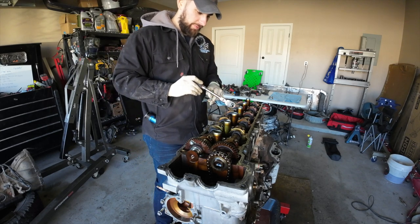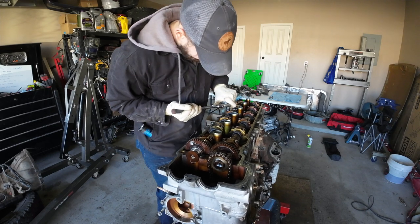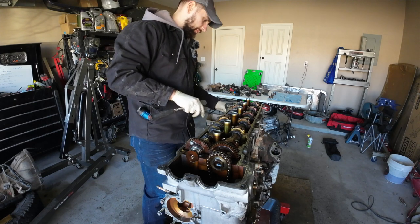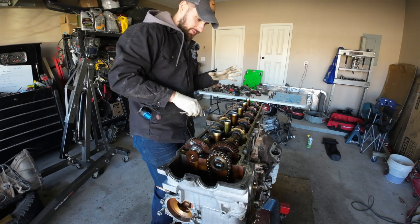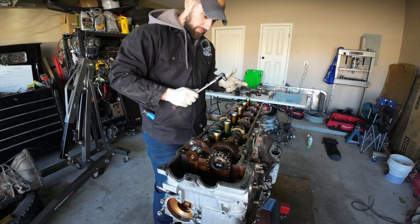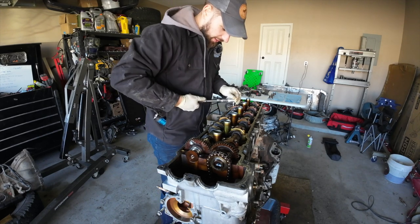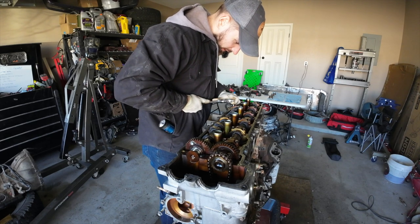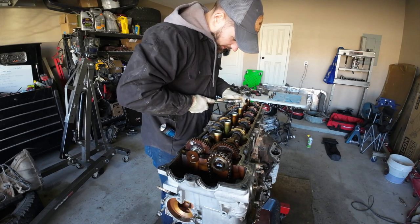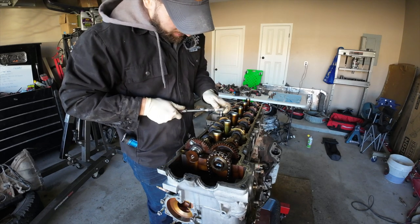We're skipping number 4, going to number 5. Crack loose. Basically make sure that this camshaft is coming up level. It's really not that stressful. Just be careful, take it slow. Literally like a quarter turn at a time. So I'm gonna start with number 7. I'm just gonna crack it loose. I'm gonna crack all 4 of them loose. Just like that. Do the same thing here. All right. I'm gonna do the same thing over here, number 4.